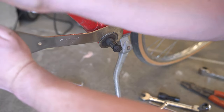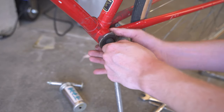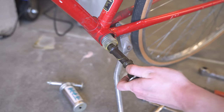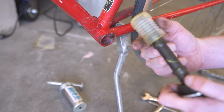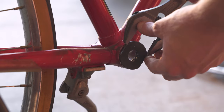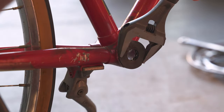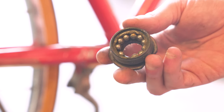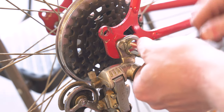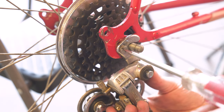There's a lock ring which unscrews, a bearing cup on both sides, and a spindle that runs across with bearings in the cups, plus a little dust cover. This is actually what I'm pretty sure is original Schwinn grease from the 70s — that brown sticky grease Schwinn really liked to use. The non-drive side is tough to get off; there's a tool for it but a good adjustable wrench works too. And there's a little set screw that helps keep it in place.